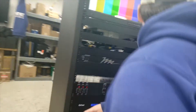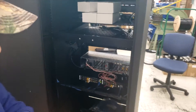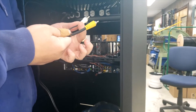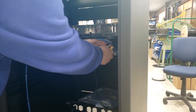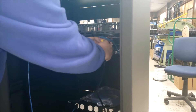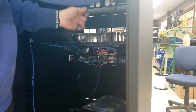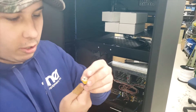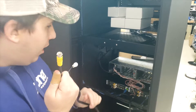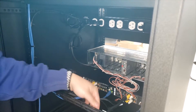Now we're going to go to the back and show you how to install the composite to RF cable. You want your yellow and your white from your input — your video source, like a computer or encoder — white in for audio, yellow in for video. We're going to take the yellow part with the RF and screw that into the top, which is the video input RF signal.